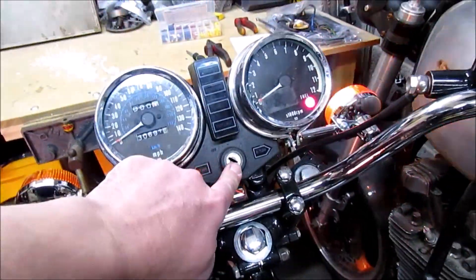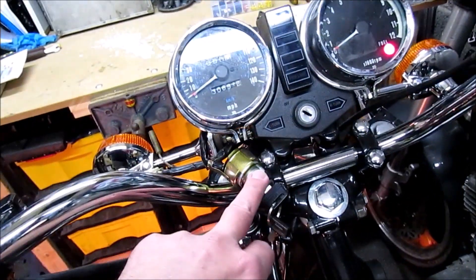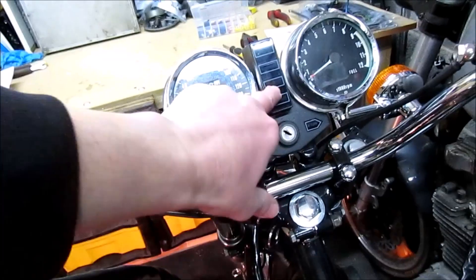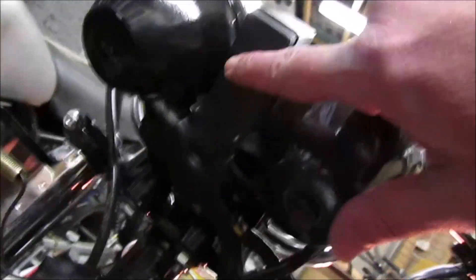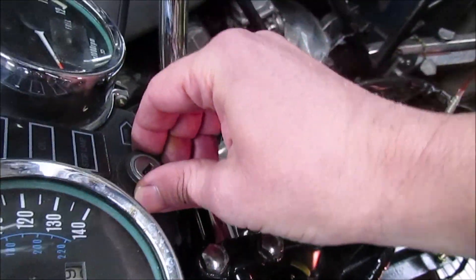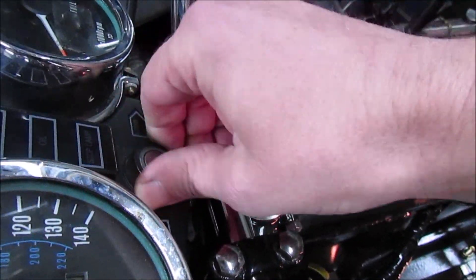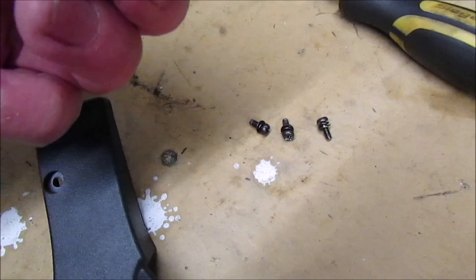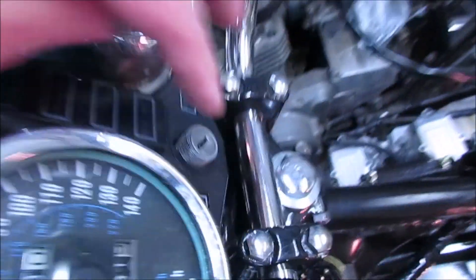Let's get this off, take out the ignition. We can fit this one in because I know now this works properly, then we can look at these bulbs and see if they're faulty. Should be a couple of screws — one there, one there, and one in there. So I take this apart and we should be able to lift the top section off, and I'll undo the ignition — that just unscrews. So that's the back off and the three little screws and the screw for the actual ignition barrel.